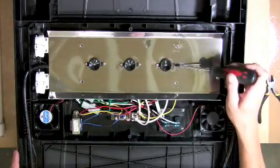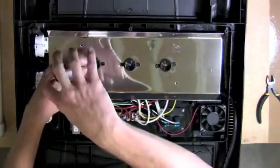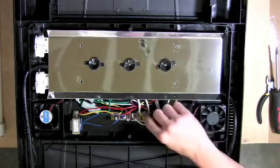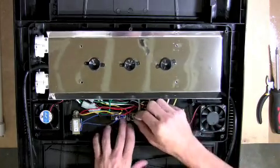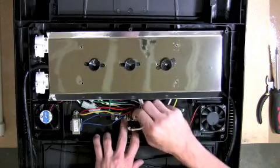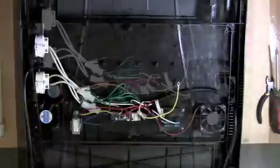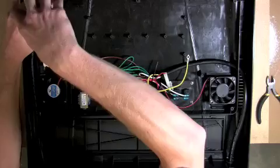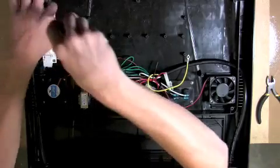Next, you'll need to remove all of the screws that are holding the stock moonlights in place. There should be 6 screws in total. Remove the 3 LED connections from the circuit board. The wires will have a white shielding on the outside. Using a Phillips head screwdriver, remove the 2 screws holding each end cap in place.